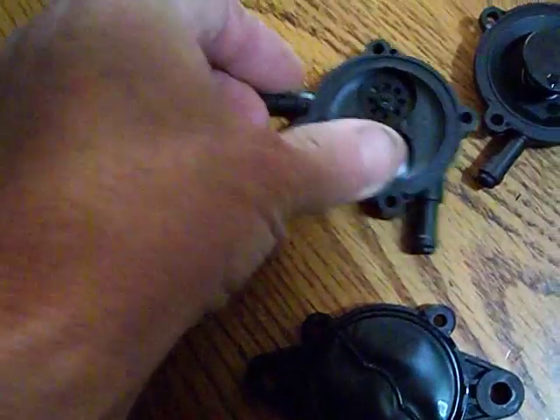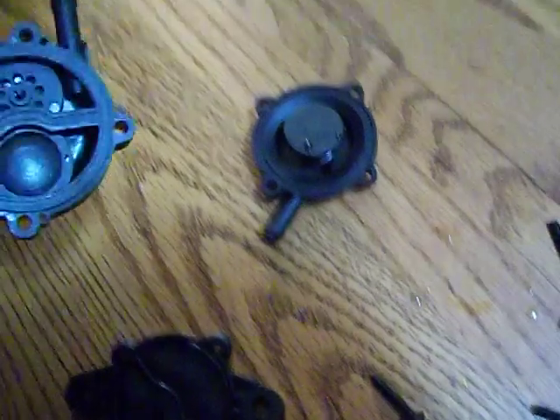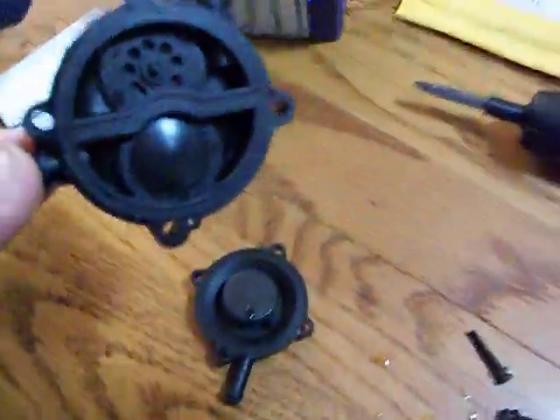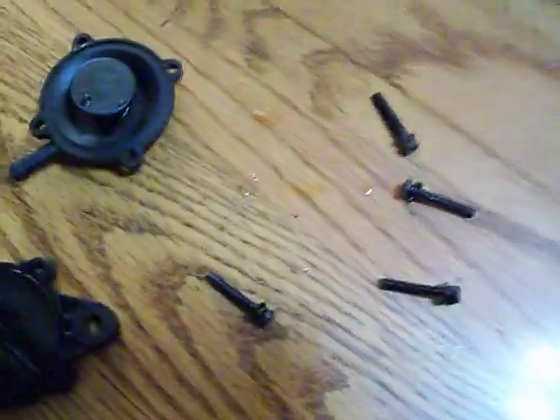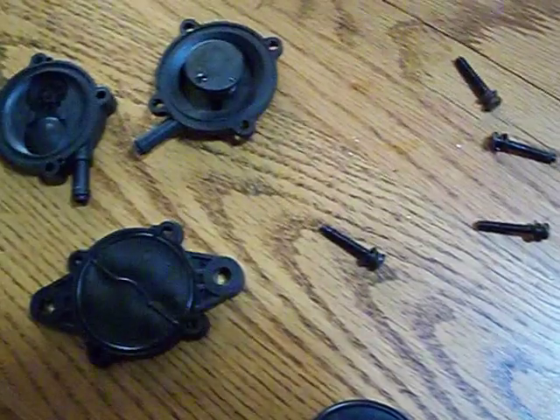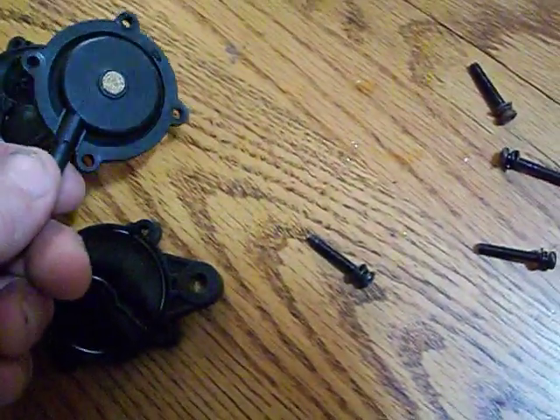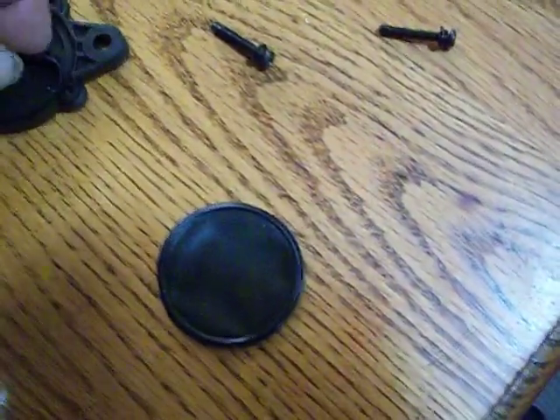The valves are messed up. Even these little dots and stuff — they would have been gone a long time ago. See that? That stuff ain't going anywhere, still sitting there. We're getting pretty tired of this. This is the second one this week — people just screwing up, don't know how to hook them up. But this one was not hooked up wrong. There was no gas coming out of the breather vent at all, which means the fuel line was hooked up correctly. There was no gas on the opposite side either. That's the bottom, but it sure is messed up on this side.